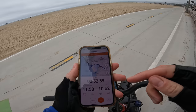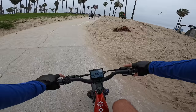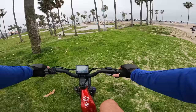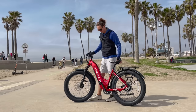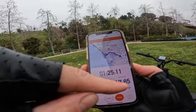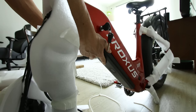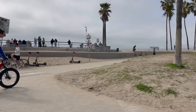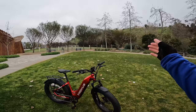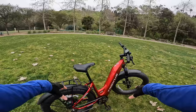About 53 minutes in and 10.5 miles, still showing 4 out of 5 battery bars. After one hour and 25 minutes and basically 18 miles, we're showing 3 out of 5 bars remaining. Based on my experience with a 48V 20Ah battery, you could probably do at least 40 miles the way I ride — I weigh 200 pounds and like to ride fast. You could probably do more depending on weight and riding style. A 20 amp hour battery pack is about as big as they come on fat tire cruisers, so if you're looking for big range this is a good option.